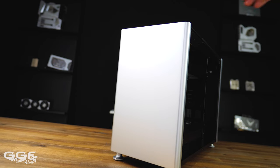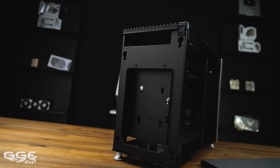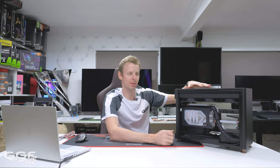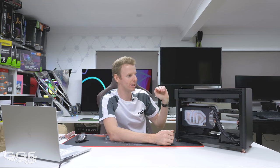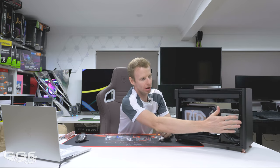Another area I really like on this chassis - I'm pretty sure it's designed for a mechanical hard drive - is at the very front you pull a cover off and there's a small compartment meant for a 3.5-inch mechanical drive. I ended up using that for all my cable storage. I actually flipped the power supply around so all the cables come out towards the front, with the bulk of cables in there and just the right lengths coming out where needed. Bear in mind I had to shorten a lot of cables - all fan cables cut to exact length - and had to extend the ATX power that runs along and feeds into the power supply.